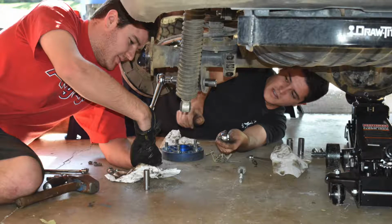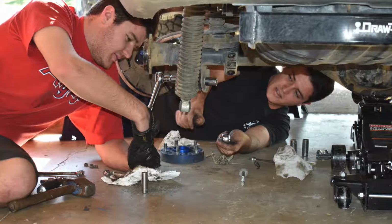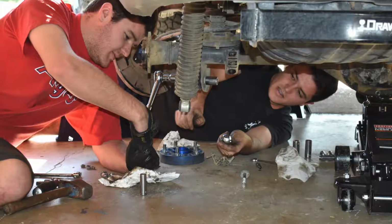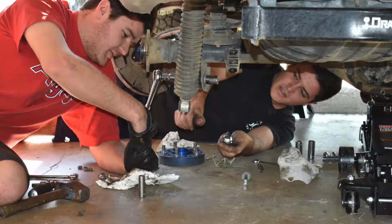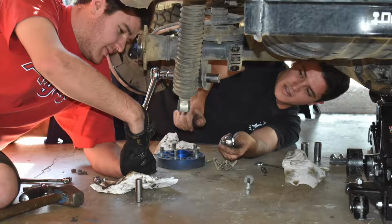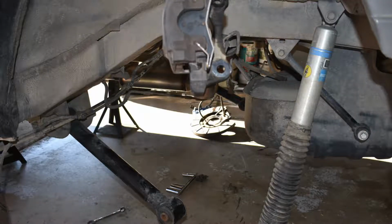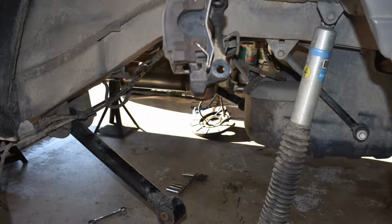Yep, right here, looks like we already got the axle shaft pulled out, e-brakes off. Now we're just trying to get that lower control arm mount off with everything else already removed, like sway bar, brakes, shocks, all the good stuff. It's already taken off. Just work on those last couple bolts. Well, bam! Axle's pulled out, no problem. Only took a couple minutes, right?